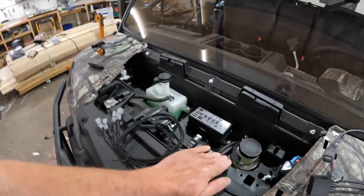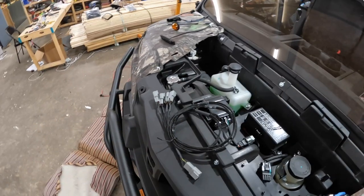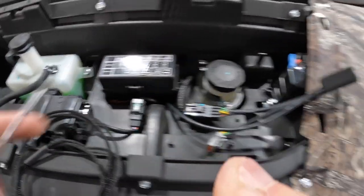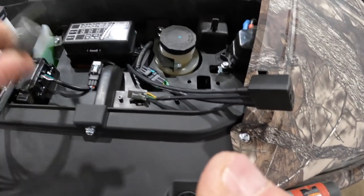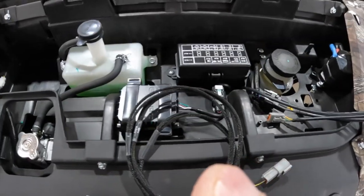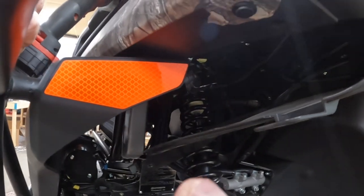Your module is going to go into this bracket right here into this plug. We're going to take the fuse block out, drop it down, plug into the brake connector, and then run our front harness. We're plugged in here — you can see our wire is ran down below. This is the module, and we'll get it all settled into place. We'll have to get the steering run through the lever, come through here and plug into that. Our front harness is right here.